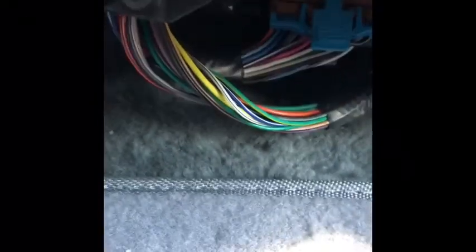Here's a tip: if you're having trouble getting those connectors to seat properly, use the end of your quarter-inch drive and put it right on the blue clip and push up. I don't like pushing against wires because if you push hard enough you might disconnect them from the connection, so this is a better tactic. Now they're seated.